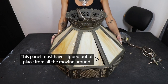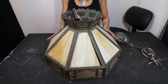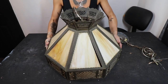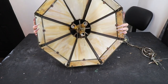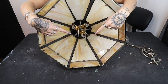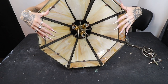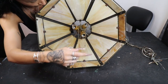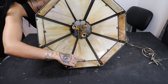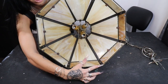So now we've got our lamp pretty much replaced as far as the wire. We've got all of the bulb sockets replaced. Now it's time for the fun part — we can actually start replacing the glass panels and really transform this lamp. Let's flip it on its back, nice and gentle because this is a heavy duty lamp. You can see all of our panels on the inside, our new freshly replaced bulb sockets and wire. Now we're going to remove all of these panels. It's pretty simple how they're held in place — at the top we've got these pressure brackets, and on the bottom we've got these screw-in brackets, which hold the bottom of the top panel and the top of the bottom panel. Then we've got two little legs down here which hold the bottom of that rectangle.